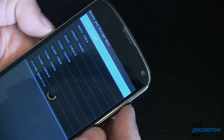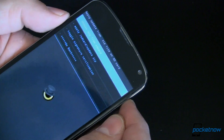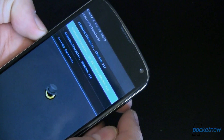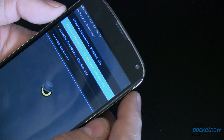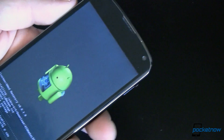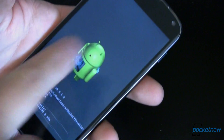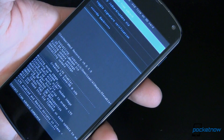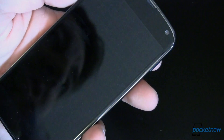I've gone ahead and downloaded this, so let's flash it. We want to install zip from SD card — choose the zip from SD. I'm in user 0 and it should be in my downloads. You can see the old versions; I was running .33. The one we want now is the .33-84 hybrid, so select that and install it. It's writing the modem image — this takes just a second. And it's just that simple; we're done. All we've got to do now is reboot and make sure our settings are correct to utilize that new radio.